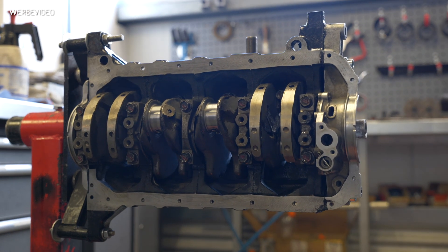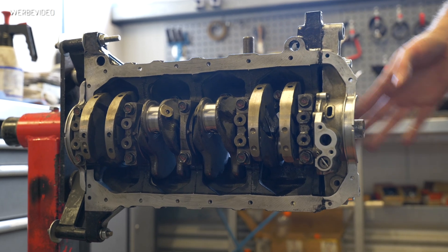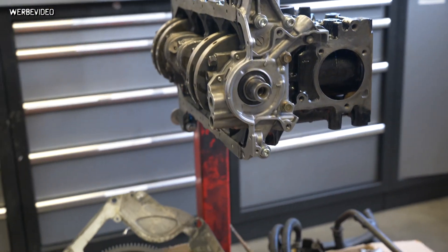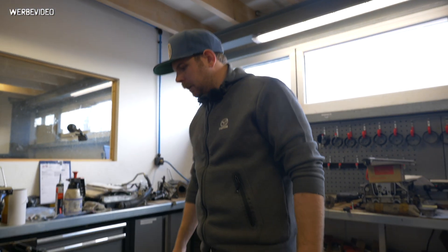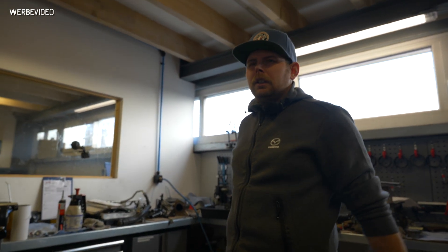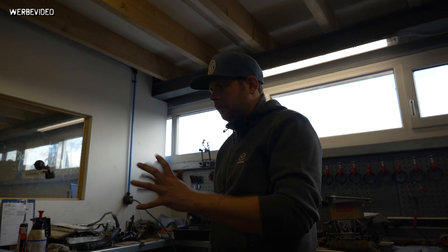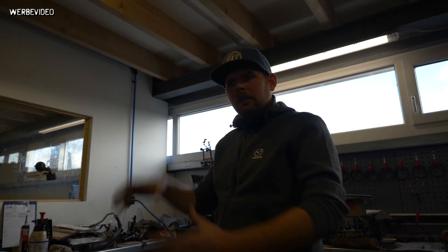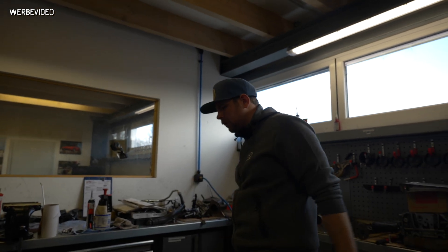On street use, go to 400hp and then switch to billets. We always use Boundary Stage 2 oil pumps — absolutely perfect, shout-out to Travis in the States. They work perfectly. We use a stock water pump. For the timing belt we use a Conti Plus — they're stronger than the originals because they have more metal liners in the belt, but they do make a little whining noise. Just be aware of that because they are really, really strong.